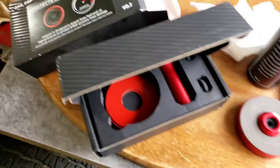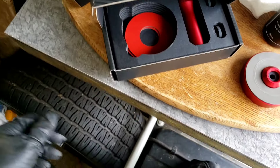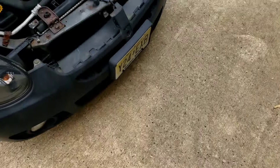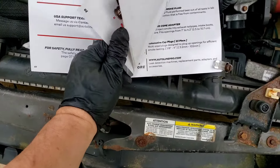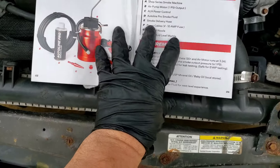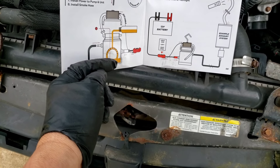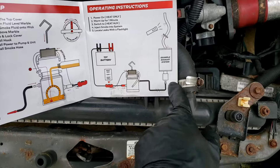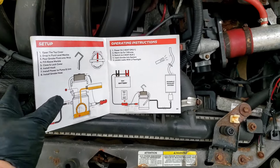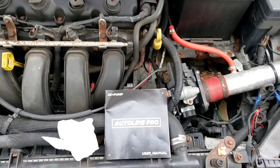Great company, great thing — I love it, it's well worth it. Years ago it was like two thousand dollars to get a smoke machine. Then they made ones you can build yourself with oil and candle oil, but you'd have to get a pump and a compressor. This is all contained in one item, and it did its job. That's the coil with the oil — fill up the oil right past the marble, turn on heat only to heat it up, then put it into auxiliary which turns on the pump. Thanks for watching, guys. Thanks, AutoLine — you solved the problem in this old Neon. Thanks for watching folks, ciao.